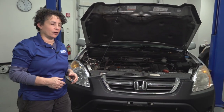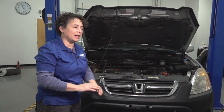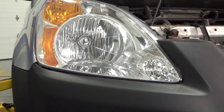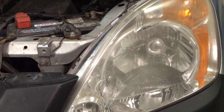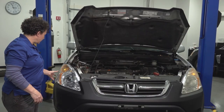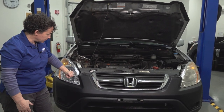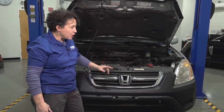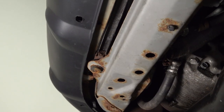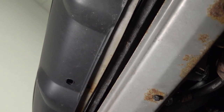We have this vehicle in the shop, and that's why I'm so excited to talk to you about this. We discovered many things about this car — it came in for something completely different. But when it came in, I noticed it had one brand new headlight and one faded headlight, and it also came with a new bumper. I noticed it has rust on it — couldn't have been hit over here. This vehicle was hit right here, hard enough to break this headlight and replace the bumper and grill, but not that headlight. That's what insurance companies do. But underneath, these people didn't realize what happened because the AC at the time was working, and that's all the adjusters care about.